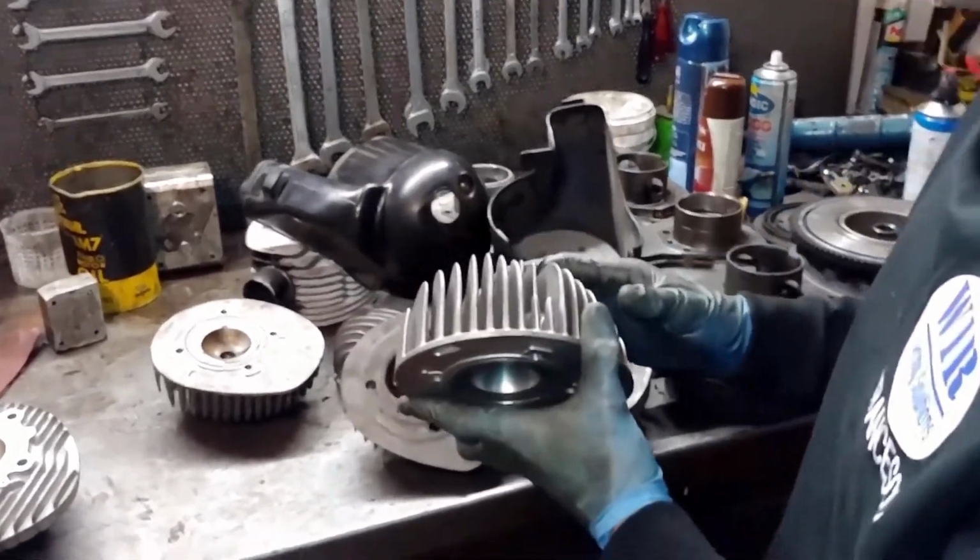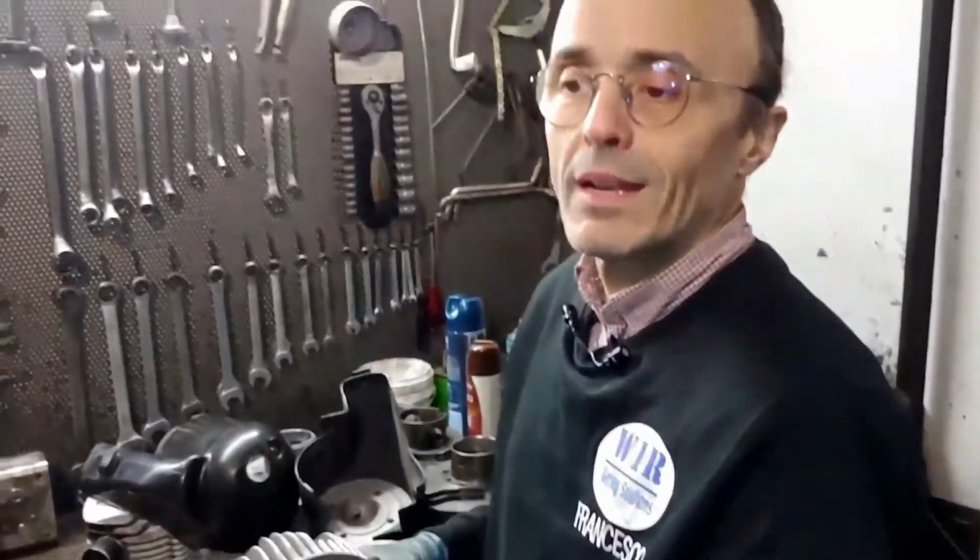So much so that now, even if I don't have it here, you will all have had the opportunity to see how the heads are made. For example, ParmaKit, even VMC is similar. They are rather massive heads, I speak in this case of the 177, and the result is very good, because that additional aluminium, apart from the fins made better and made so that the air circulates better, means that on one side the head has a greater thermal inertia, and on the other, points where there are high temperatures cannot form. There are hot spots, particularly overheated areas. I like the detail, this is very important.